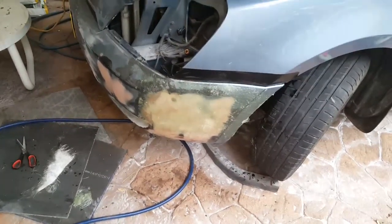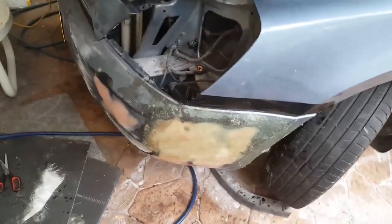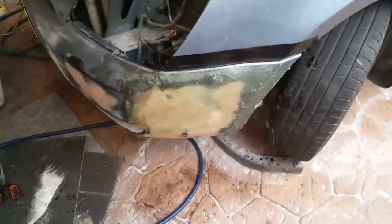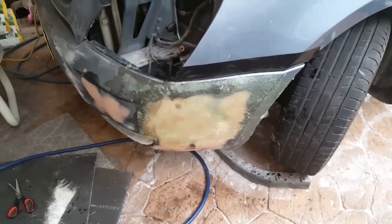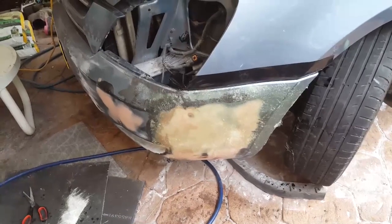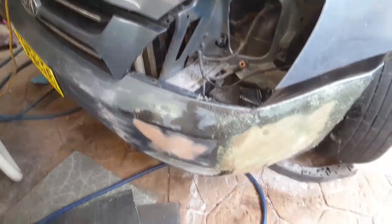So now it's basically sanding it back, using the spray putty. It's around there somewhere. Anyway, it's like an undercoat spray putty. So sand it back till I've got it pretty much nice and smooth, and anywhere there might be a little hole, whatever, the spray putty will fix that up. Run it over again, and then I'll be taking this whole bumper bar off, so I can sand the entire thing back and paint the entire thing.